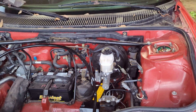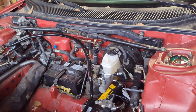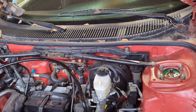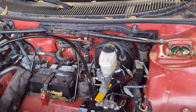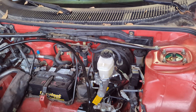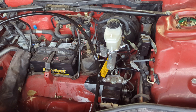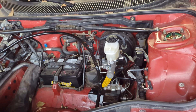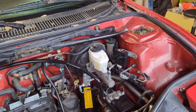I want to emphasize: this isn't giving you increased pressure or anything like that. This is simply to help your braking response. Because there is a larger bore in the Tacoma master cylinder, it should move more fluid with less travel of the brake pedal. So all this is is a stiffer pedal feel and shorter travel. I'll leave some commentary at the end of the video as to how it feels. I only installed this because I was already having brake pressure issues. I'm going to go ahead and bleed my brake system, bleed all my brakes, make sure I have pressure everywhere, take it for a test drive, and then add comments on how it feels — is it worth it, should we stick to OEM, pros and cons?